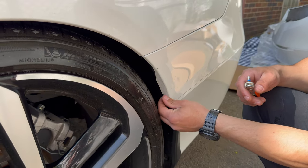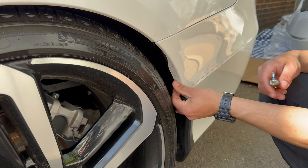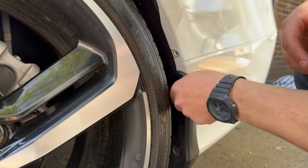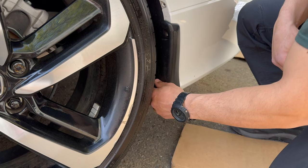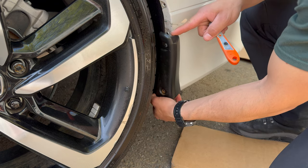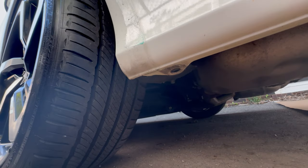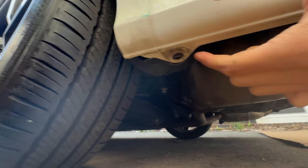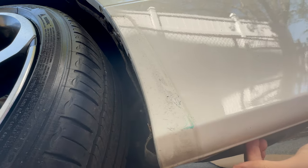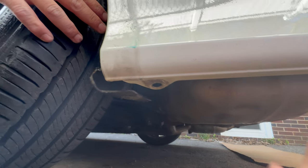It's a little bit harder with my car since it's already lowered, but if you have standard ride height you should be good — it shouldn't be as hard. You could just use your hand to take it out once it's loose. There's a clip on the bottom too. Alright so this was the last clip that we had to take out right here — it was connected to this so the bumper wouldn't come off. Now you guys can see it can just come off easily. We just gotta do it to the other side too.